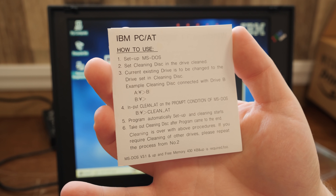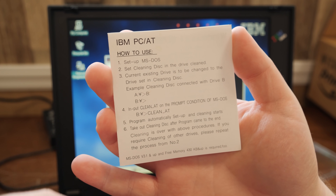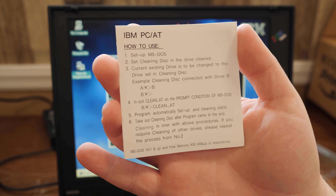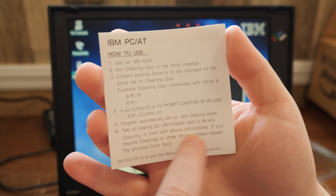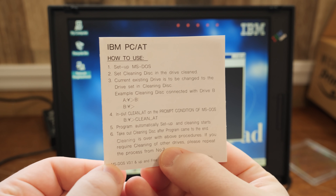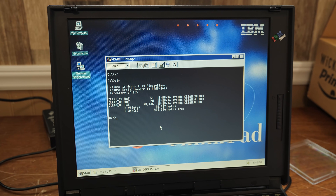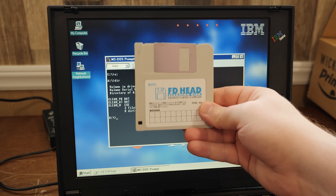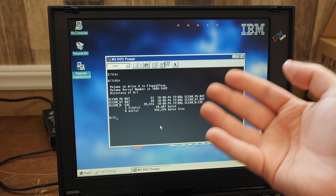You just insert it, change to the drive you need — so if you're at the A drive, you go to the B drive or whatever, just an example. Basically you want it selected at the right prompt. You type in the command for your system, the program automatically sets up and cleaning starts, then you take out the disk after the program ends. Repeat the procedure if you need to clean other drives. This is important because a lot of folks were wondering: is this made for dual floppy systems, where you insert the A drive here and have the dry one in the B drive, and that's what physically cleans the other drive? Well, no, it doesn't do that. I had it in a dual floppy drive system in the previous video. Whenever you run this TIAC program, whatever drive it's inserted into, that's what it's reading from — and that's it. It doesn't access the other ones at all.